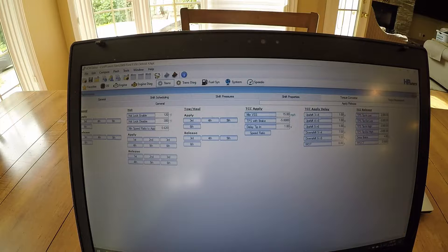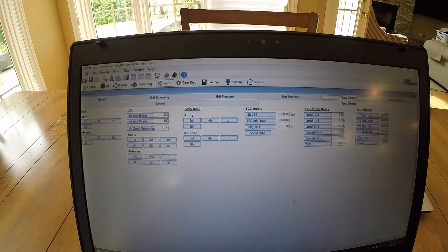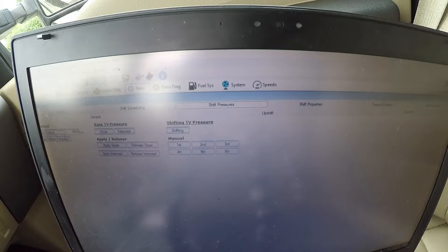I'm still learning. I changed all the torque converter application cycles — I think they come stock at four seconds, and I've put them to one second. So torque management is all disabled. Anyway, I highly recommend this program for anyone that wants to tune their Cummins or any other engine for that matter. It makes a 5R110 usable behind basically any engine.